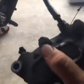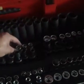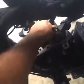And you've got your brake caliper. Let's come on this side. Brake caliper mounting bolts are internal Torx as well. So we'll come over to the toolbox. Got internal Torx bits, standard here. Alrighty. 1/2 inch. So once we go by hand, we start out torquing them low torque. I think the book says like 12, and I think the final is like 42. So we'll torque that in a minute. We'll get this other cylinder head installed.